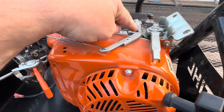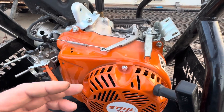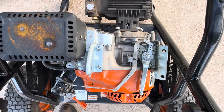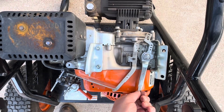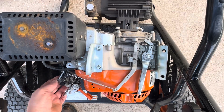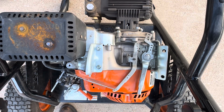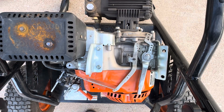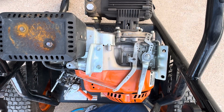I'll show you what happens when you adjust this the wrong way — you can get it wrong, but you shouldn't. To adjust a small engine governor, you want to make sure your carburetor is in the wide open position, so make sure your throttle is wide open and the carburetor is not at idle. It's so easy — all you need is a pair of pliers and a 10 millimeter wrench in most cases.